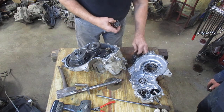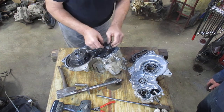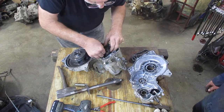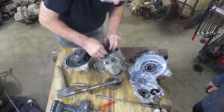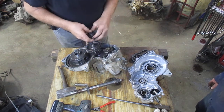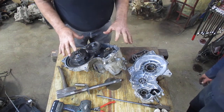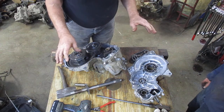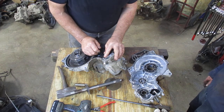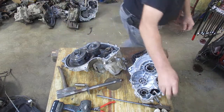All you do is take this cog, turn it upside down, and stick it back on — just reverse everything. Push it in and then reverse what we just did, and you'll have no more problem jumping out of gear in forward. That's the tip of the day and we'll hopefully get some more stuff going for you pretty soon.